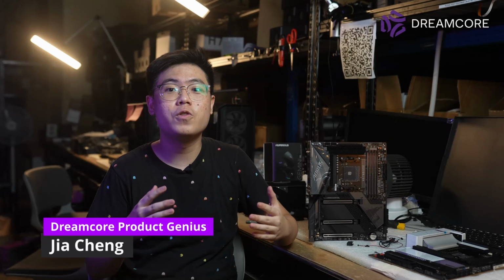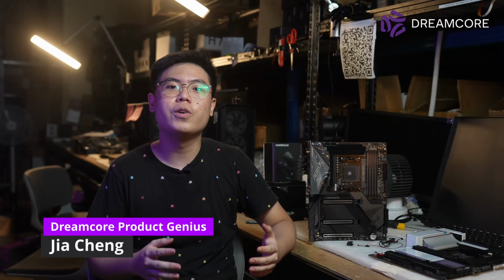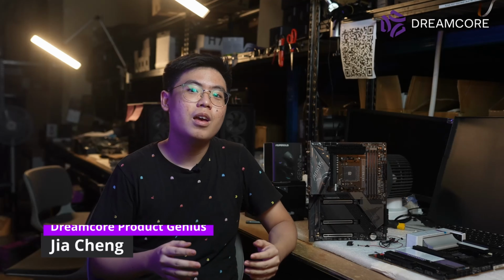It has been a full 2 years since the original release of the Ryzen 3000 CPUs and the X570 chipset motherboards, bringing PCIe Gen4 to consumer desktops for the first time. But PCIe Gen4 also brought with it increased power consumption of the chipset, forcing motherboard manufacturers to add tiny chipset fans that spin up to 10,000 RPM.